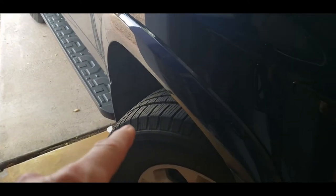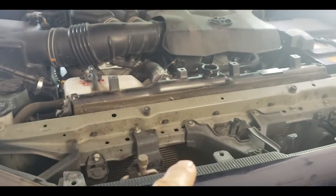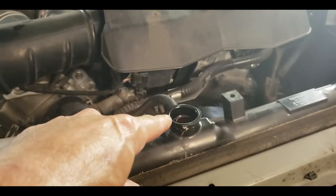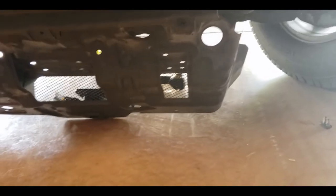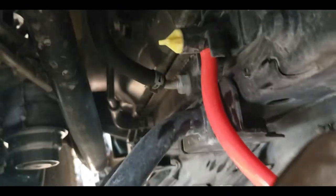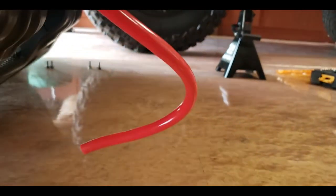Pop the cap off and I'm going to work on the driver's side to get the rubber flap off. On the Lexus GX, if you've seen that video, the petcock was on the driver's side. I dropped this — it's four bolts, takes two seconds. You can see down there is the radiator petcock. I'm going to put those Harbor Freight tubes on it and run it out into the oil drainage container.